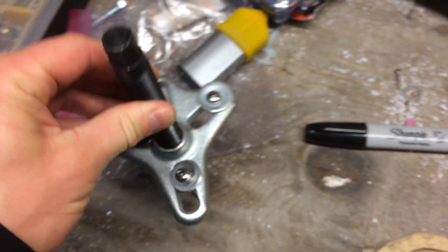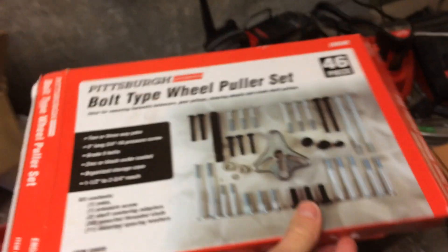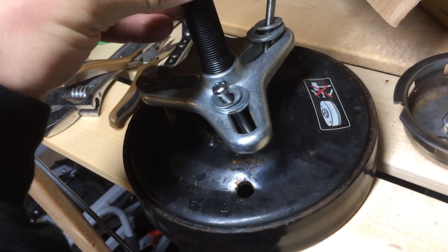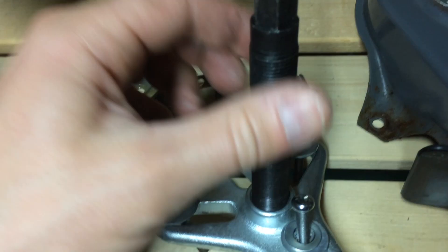Here's the flywheel — it wasn't too bad to get off. I used a Harbor Freight flywheel puller right here; it's a bolt-type wheel puller that also lifts big outboards like 150 four-strokes. I thought pulling off the flywheel would be a pain, but it's actually really easy. The wheel puller just sits right on there, and these 10-millimeter metric bolts screw right into the same holes that the cup goes on. You twist it down and it pops the flywheel.